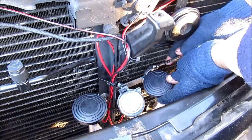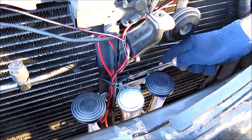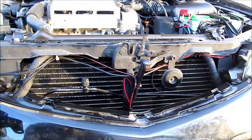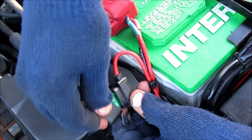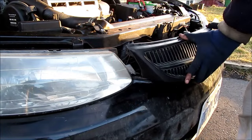Next I'm going to tighten up the horn bolts here and make sure they're nice and snug, tighten up this horn, and tighten down the compressor bolt. I've got my wiring all tidied up with zip ties. I can go ahead and put my headlights and grill back on. The final step is to install the fuse — I'm using a 30 amp fuse to make the horn circuit live. Then I'll install the grill.